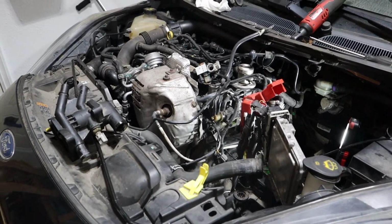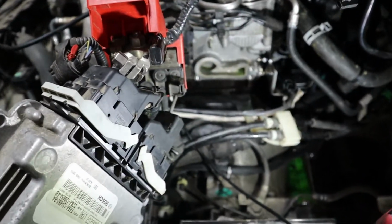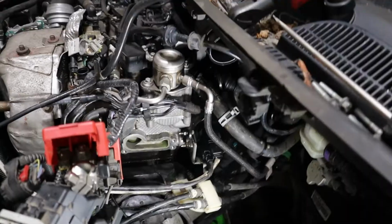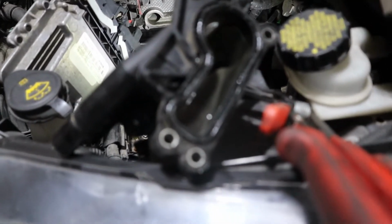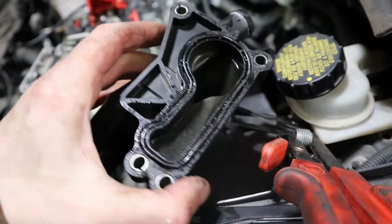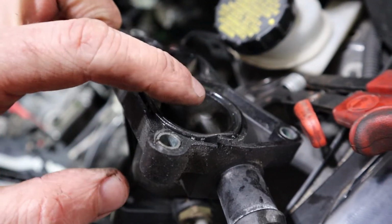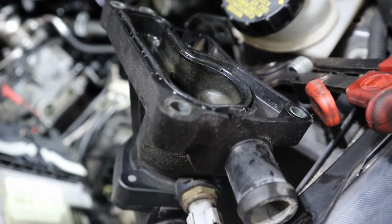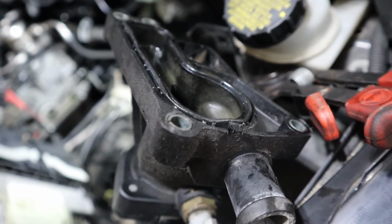Okay, so we've had a bit of a coolant leak here. It was dripping underneath the car, and I've had to take it apart again. You can see I've got the thermostat housing off of the side of the cylinder head. I think I put a new gasket in it, but it's been too long. If you look really carefully, you can see that dip in the gasket, right here. It's like it's squished funny. So I'm gonna pull the thermostat housing off the other cylinder head and see what that gasket looks like. I might just use that one. We'll see.